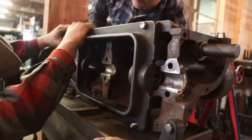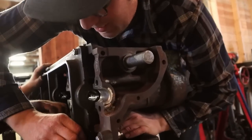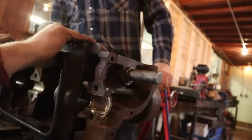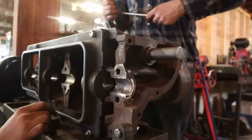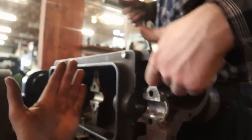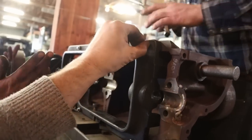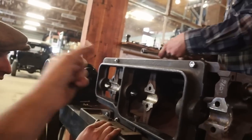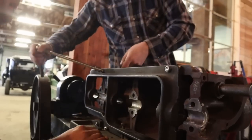And then I can get this one through. There we go. Just one. Let me just wiggle this up, you see, until it bottoms out on there. Tight. And now you tighten these. Nice. Centered. Because that's machined, that hits your distance there. And this way is just off the bolts, which is not as important, because you face that separately, in a separate process.